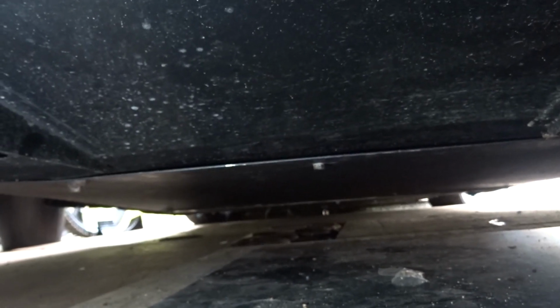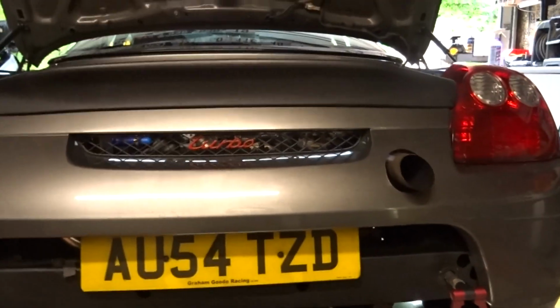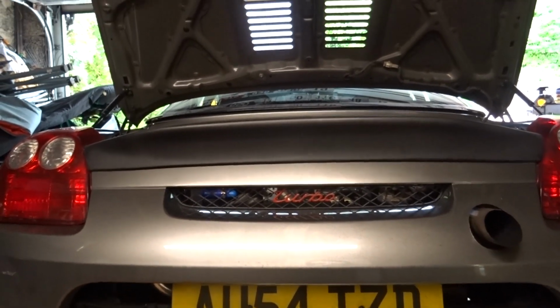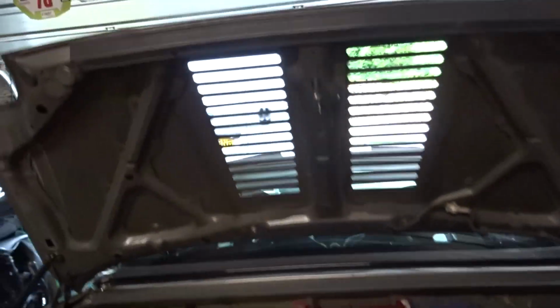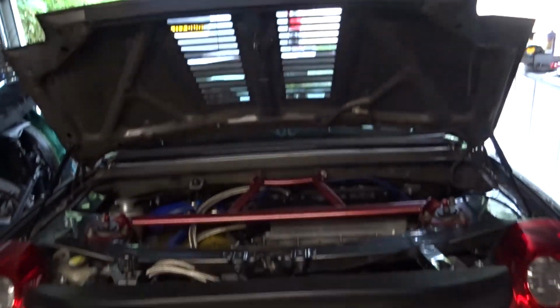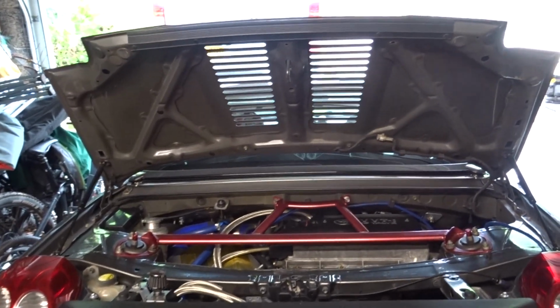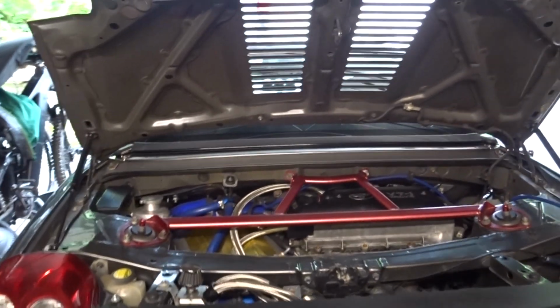I had a really big spin through and bumped over the curb and bumped through some grass, and I think if that had been an aluminium flat floor as opposed to the galvanised one that I've got at the minute, we'd have probably ripped it off and would have been in all sorts of trouble. But it would have been a bit heavy and a bit more robust. It adds about 20 kilos to the car. I'm not really bothered about those sorts of weight increases with the kind of power figures I'm aiming for.